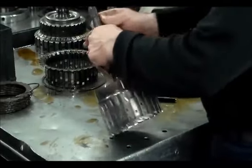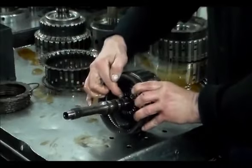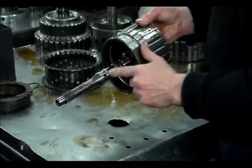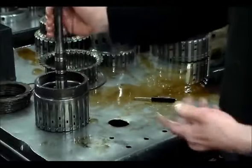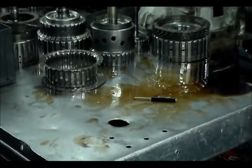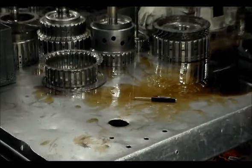rear stator bushing. The rear stator bushing rides here, down here. So that's a nice surface. And as the bushing wears, it allows the oil to leak. That applies to the E clutch, and the E clutch is on 4th, 5th, and 6th. So if you have issues with the higher gear ratios, like 4th gear ratio errors, 5-4 gear monitoring, 4-5 gear monitoring, it's usually due to that bushing.